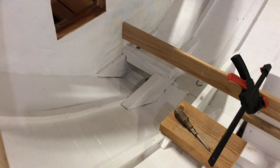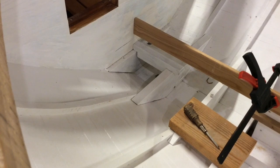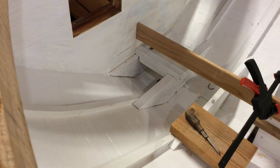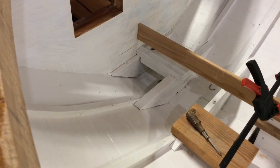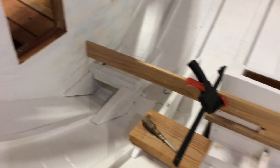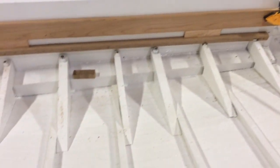So basically I just moved it up there based on the idea that the runner's right, and it's 1 1/4 inch up above it. Now I know I can take that 1 1/4 inch little block, put it underneath that, because again, that's still going to represent the bottom of the floor framing, or the decking, that perpendicular board in there. Mark 1 1/4 inch down below that, and then I know that's where it needs to be the bottom of the cleat that I mount on the bulkhead. And I think that's going to do it. Now we should be able to do that, get a runner on each side, and then start building the floor framing out away from that back into the ribs.